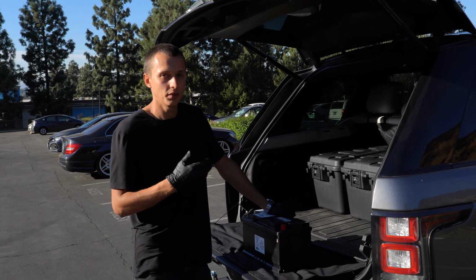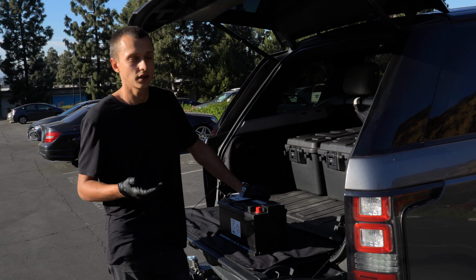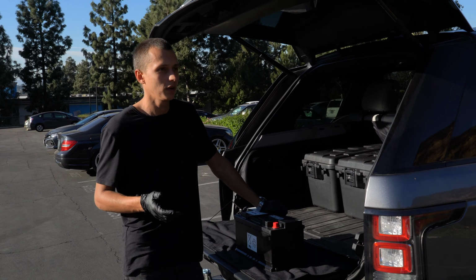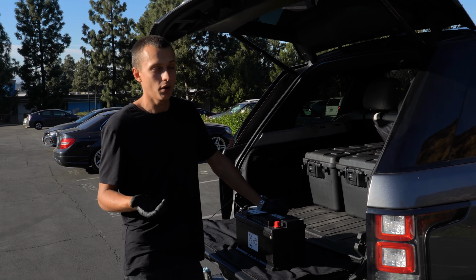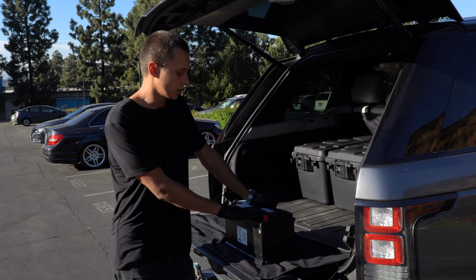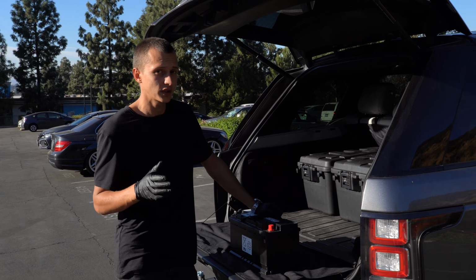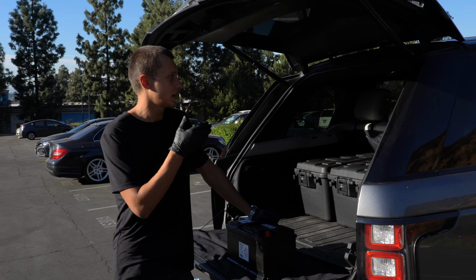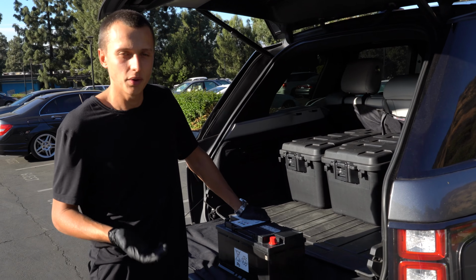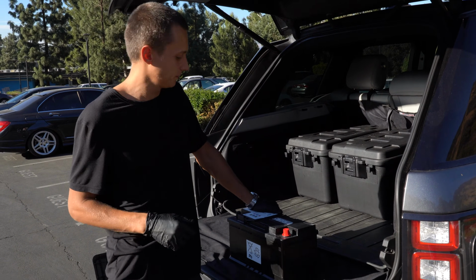If you connect an OBD reader to your car and check voltage while you're driving, sometimes you can see like 12 to 12.5 volts, and that's normal. That's how BMS works. It turns off the alternator while the battery is charged. So when the charge goes down to like 50% or so, the alternator starts working again and charging your battery. For a long life for your battery, you need to reprogram it, and I'll show you how.